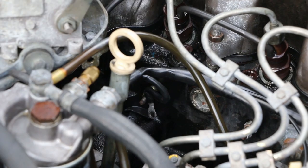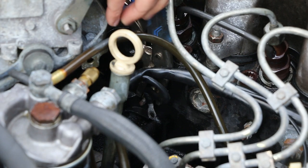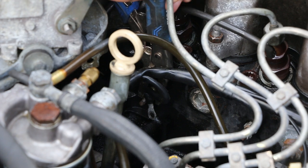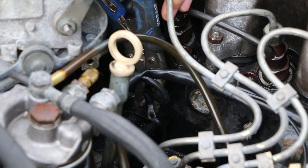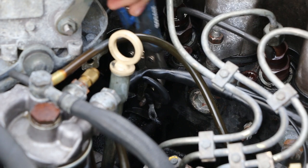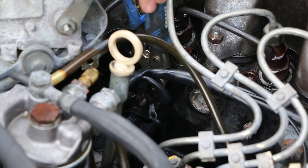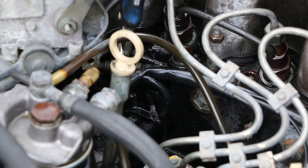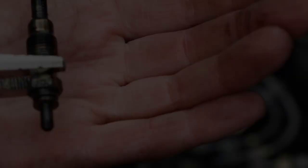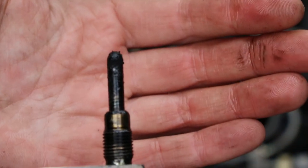I'm going to get in here with a pair of vice grips and put a little pressure outward on this because I'm past the threads but it's still tight, which tells us there's some carbon built up in my pre-chamber. Let's hope that came out intact — it did. And you can see there is definitely some carbon built up on there. So what do we do if we've got carbon built up on the end of our glow plugs?